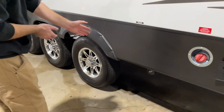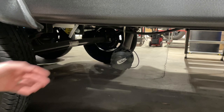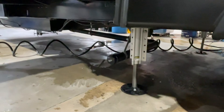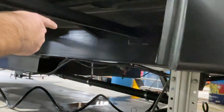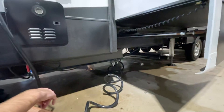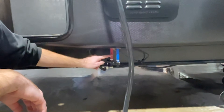This drain is going to be for your galley tank, or gray 2 tank as it shows up on your monitor panel. Below the slide room you have your drain outlet for the black water and gray water tanks. Just up higher along the frame line, the red line with the black valve and quarter-turn handle is your fresh water tank drain. Around to the front of the slide room you see your drain handles for the black water and gray water tanks — color coordinated so there's no mixing them up. Right down here you have your low point drains: blue is for the cold water line, red is for the hot water line.